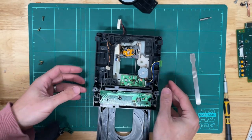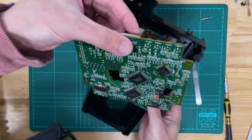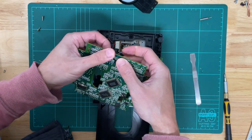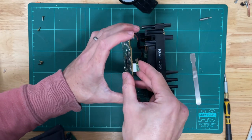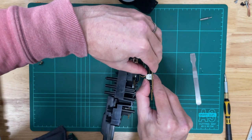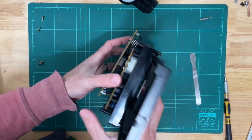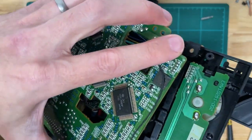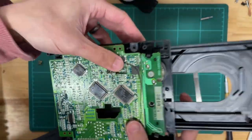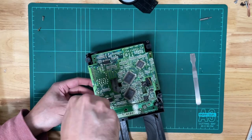That's the top part done — we just flip the unit back over and simply replace the PCB, doing the initial steps in reverse order. We do the same for the side connector: the green one clips in there. Flip the unit over and the third and final connector wire snaps in. Then we guide the four-pronged connectors into the sub-motor PCB — they should go fairly easy. As long as you've got it aligned, it just slides down. The final step is redoing all the screws: the PCB and then the top part of the CD tray.